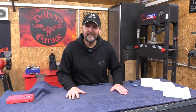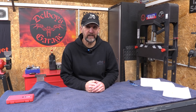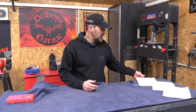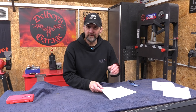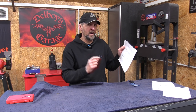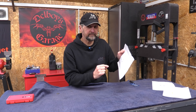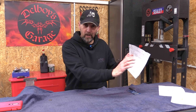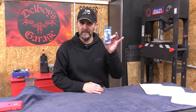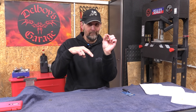Good morning, welcome back. In this little series of videos on valve clearances on the XJR, we're covering the critical steps one video at a time. In the first video I showed you how to measure the valve clearances, determine what they are and record all those clearances on paper. We discovered that every one of them — all 16 — are too tight. In the second video I showed you how to use this little tool to hold the two shim buckets down so you can get the shims out and read the number on them.